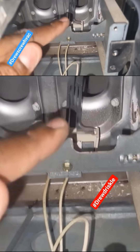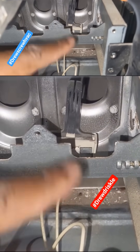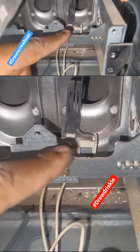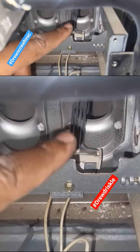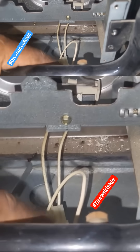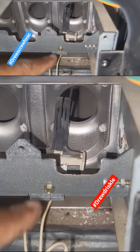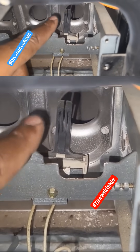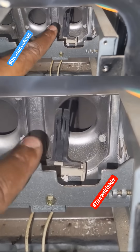Because if cracks show up on the igniter, even if it ohms out within range, that crack getting worse is only a matter of time before the igniter breaks. I actually saw that before — a couple years ago doing maintenances, I only went by the ohm reading and never visually looked at the igniter. Sure enough, I ohmed it out and it was at 52, and the next day it broke. I was flabbergasted, but lesson learned: always get a flashlight when you ohm out your igniters.